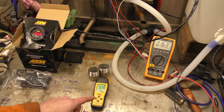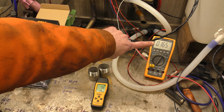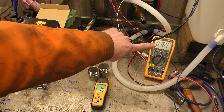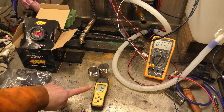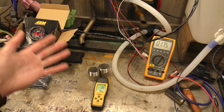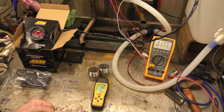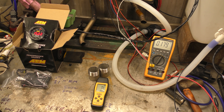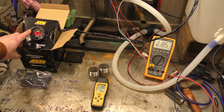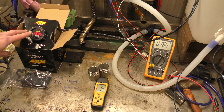There goes the carbon monoxide! We also notice there goes the temperature. More fuel is more heat. We're now over 1,000 parts per million. But look at the heat - more fuel is more heat. If you want this to go hottest - wow, I can actually see black smoke. Seven might be too much. Look at the air-fuel ratio - it's come way, way down, it's like 15. That's like half of what it was, which makes sense because we added just like twice as much fuel.